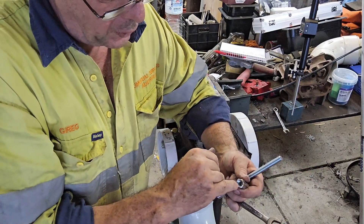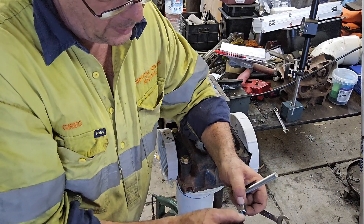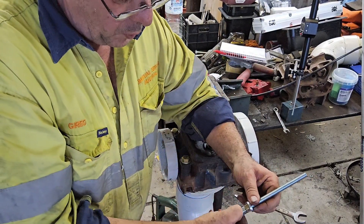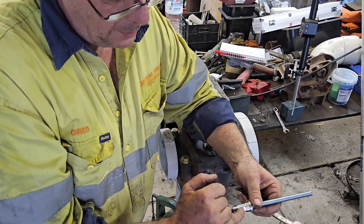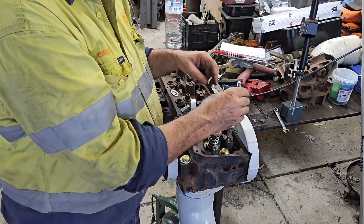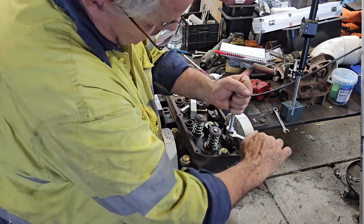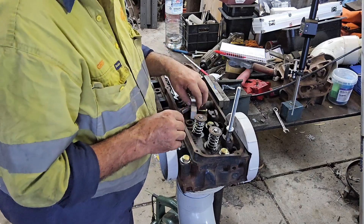What I've done here is I've got in with the drill and drilled this to tapping size for a 3/8 thread, and then tapped it halfway down — 3/8 UNC. So it's 5/16th one end, 3/8 the other, and that's how I've done that. You can do that freehand — just hold the nut in the vise, work out what halfway is on your nut, drill it down to halfway, tap it down. Make sure you've got a bottoming tap because you're going to want every thread you can get. What this lets me do is gives me an adequately rigid mounting point.